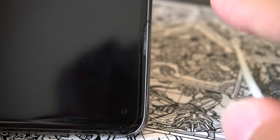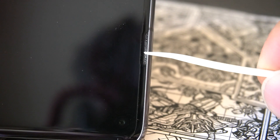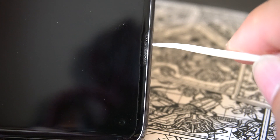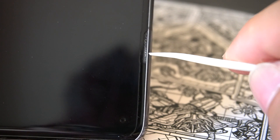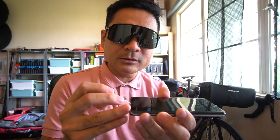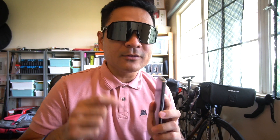We can't actually remove all the glue stuck on the mesh wire, but hopefully by trying you can get one or two pieces out and the volume will return to normal. I was lucky — after scraping, two or three pieces of glue came off, I made a couple of test calls, and the volume was just perfect, back to original. Hopefully this video gives you a solution, and I'll see you in the next one.